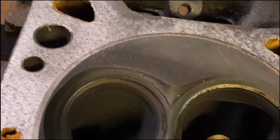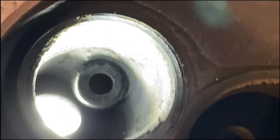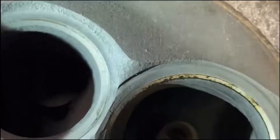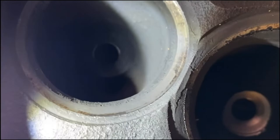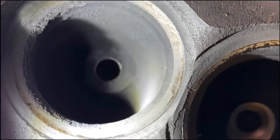So I've got a ridge right on top of where the valve comes through — I'm going to massage that, as well as this sharp edge here. I will take this lip down slightly and clean all this carbon out of here. I'm also going to address this little lip right here before the valve seating surface. When the valve is starting to open and you have hot exhaust gases escaping through there, the first thing they'll hit is that lip, that little ledge. The valve seating surface is the most important part, so I'm going to leave that alone and just dress right around where the gases are exiting.